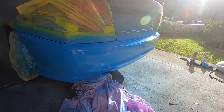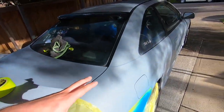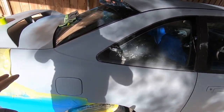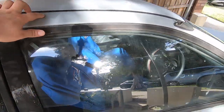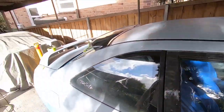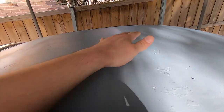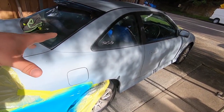I'm just going to leave it at the rear bumper for today. The next plan is to sand over the entire car — I'll start this side first, fix up any imperfections, dry patches and random stuff that's gotten into the primer. Once all of this is sanded down and cleaned up, we'll start applying the sky blue color. I'm probably going to do the roof last because it needs rust converter, bog sanded flat, and re-priming — it's going to be a big job.